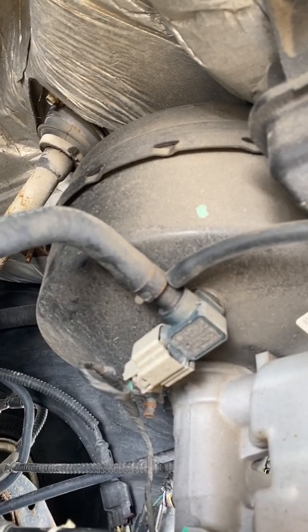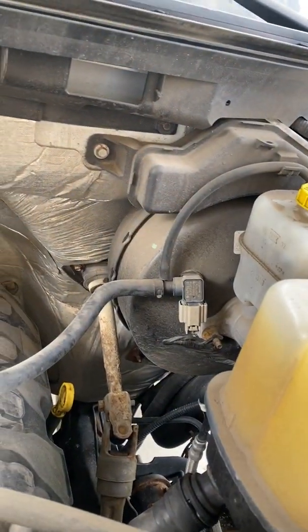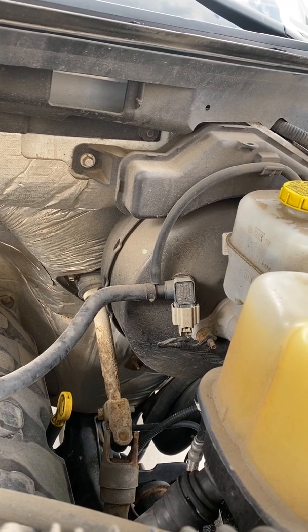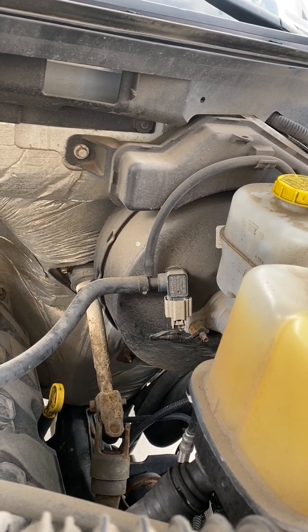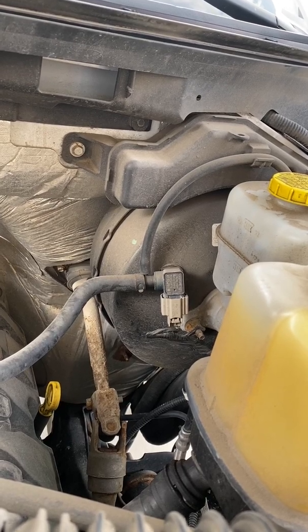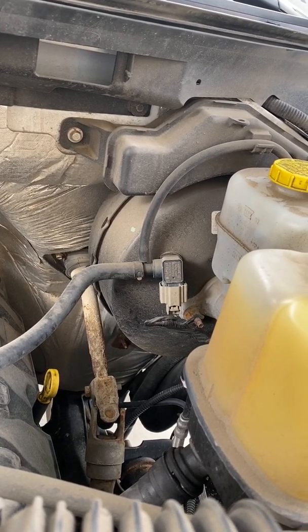But anyway, our vacuum booster actually serves two purposes. Of course, the way it works is it uses vacuum difference or pressure difference to apply the brakes, and all the moving or mechanical parts are inside that canister right there, and that's one of the purposes, just the inner working parts. But also keep in mind that thing is also a vacuum bank or a vacuum tank.